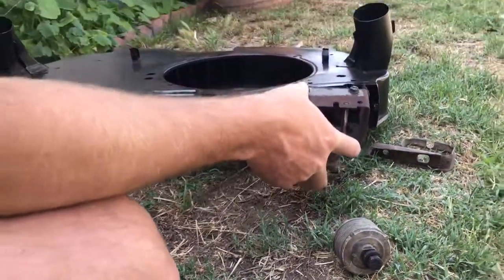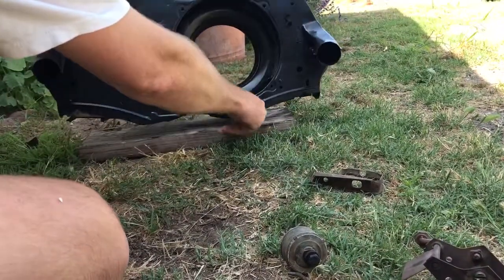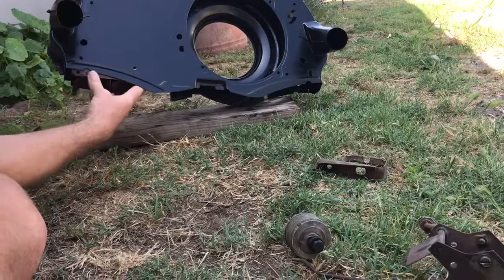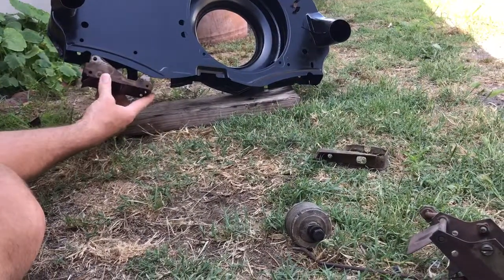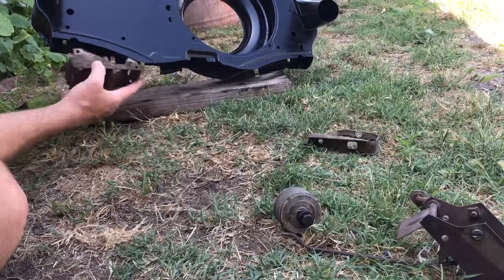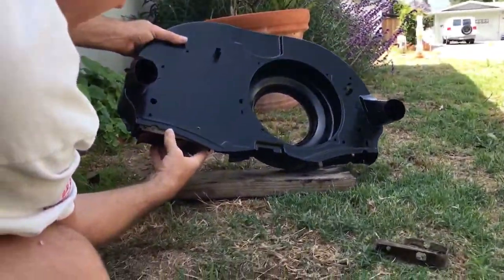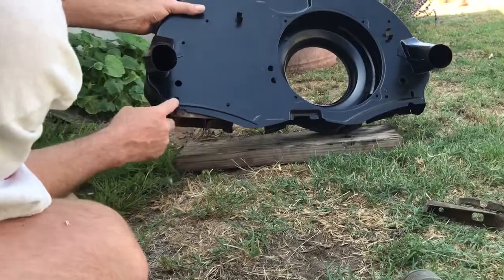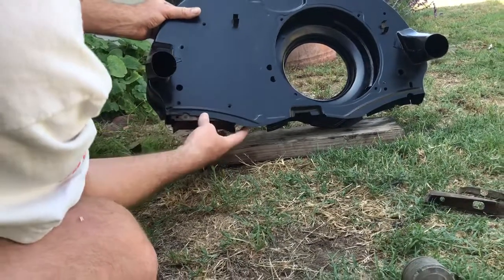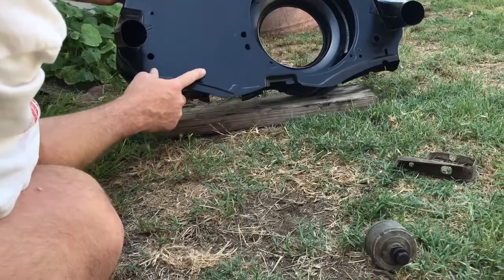A lot of people over the years removed these things. If they're removed, when you see the engine in the bus, you'll notice there are holes right here — and you can see how this is the other side, for the other two cylinders. This thing basically slides up in the engine shroud. If you're looking at buying a bus or a bug or whatever, you may notice these are just empty holes and you're letting cool air flow through these holes, which is not good.